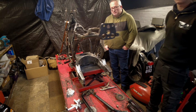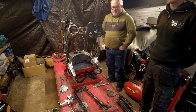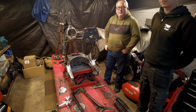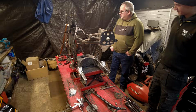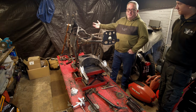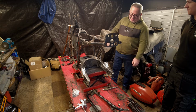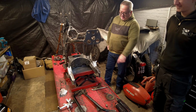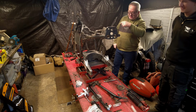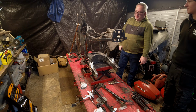What's the swing arm actually from? It's a GSXR 600 swing arm, and then you put in a Ninja front end in it, is that right? Yeah, ZX6 front end to go in. So it's right way up, but it's more modern suspension with better brakes, because these old brakes are rubbish, aren't they? Yes, you're running radial brakes on it, etc. Yeah. And then I've got a Bandit rear wheel, the 600 rear wheel, to put in, so it's only 5-inch wide, because I don't want to go much bigger than 160 on the back.